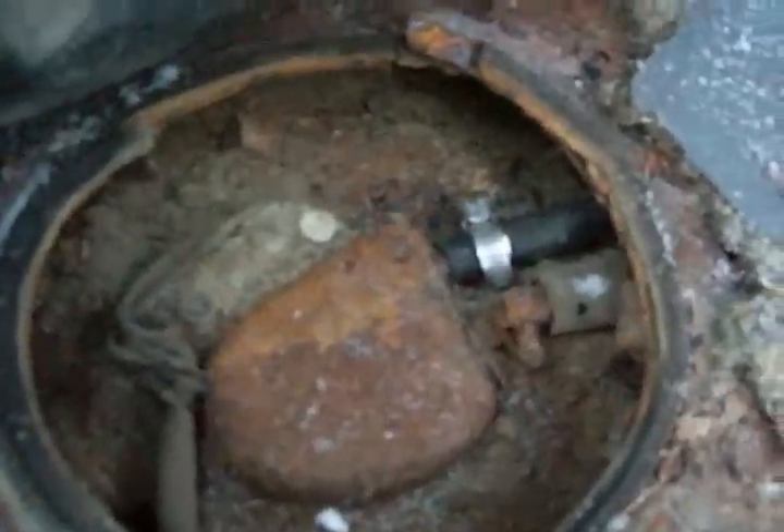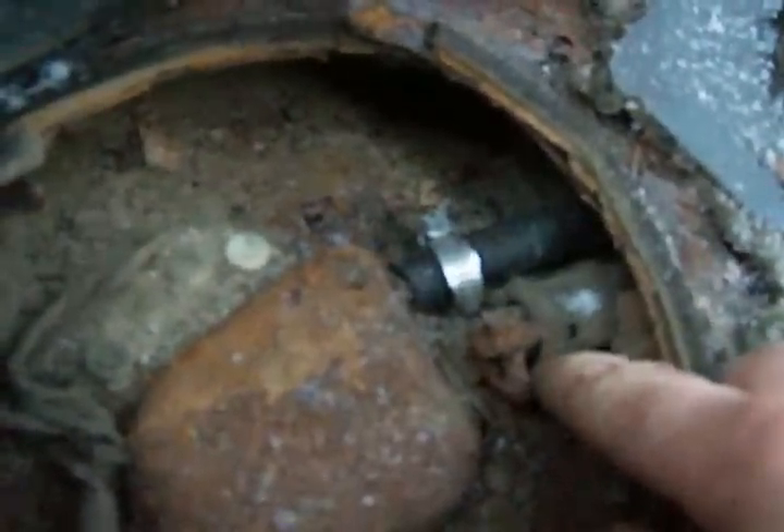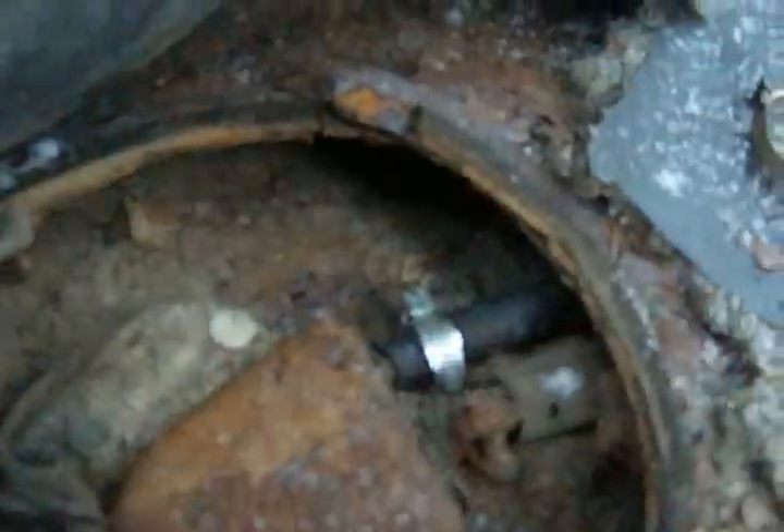I figured out which one was the fuel pressure side, and hopefully I'm gonna do this one first — I might end up doing the other one too. The hose was a bit too big but the hose clamp should tighten down enough to seal it. I've cut the fuel line here and I just ran the rubber hose. Since this is just a plow truck and it's not gonna be on the road, this will do me for a little while anyway till I get to work on it. I'll tie-strap all this up in place.